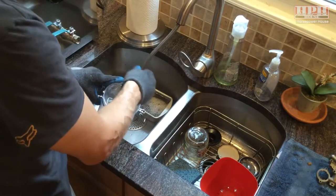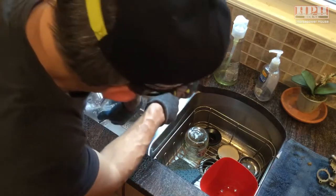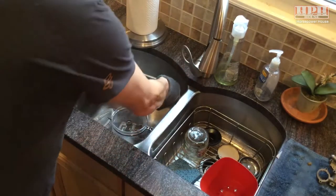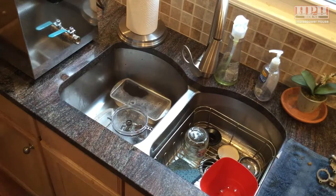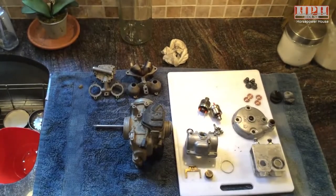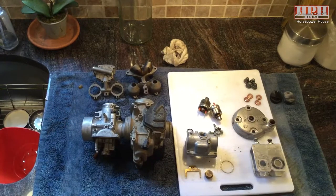Mind you, this is my first time using this tank and I've been using it all morning at various lengths of time. I started out with 10 minutes and it looked good. Look at this nasty liquid that came out — this has been in for more than 30 minutes total. So let's have a look — this is just an old carburetor. I've done nothing: I haven't cleaned anything by hand, I haven't wiped or brushed anything. All I did was throw it in the tank with 30% solution.